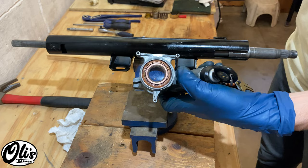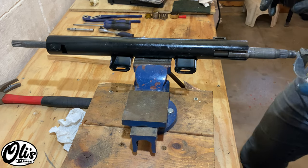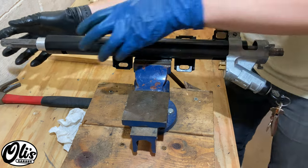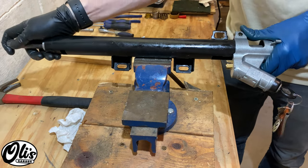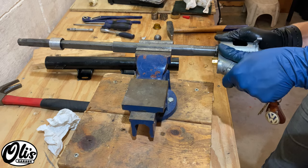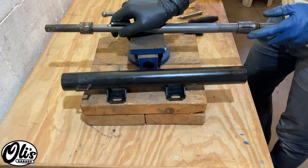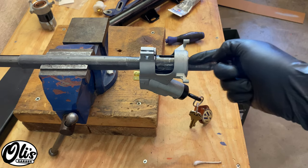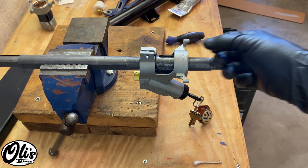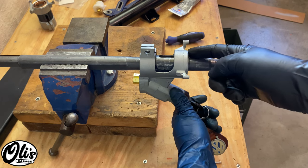Just like that. Then take some grease and grease this shaft right here, and then we can slide the ignition lock cylinder on. It's a pretty tight fit up here — some patience and wiggling go a long way. Make sure that you slide the steering wheel lock cylinder on all the way. Quick note: this new one slid on significantly easier than what you saw me struggle with on the old one. I tried to press out the bearing on my old one so I could repack it with grease and ended up deforming the bearing during the process — that's why I bought a new one. Note to self: don't try to press out that copper bearing in there.